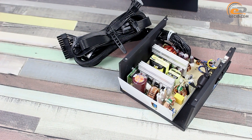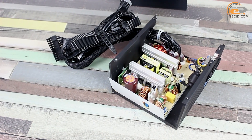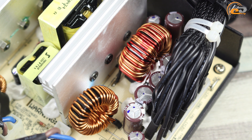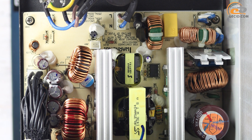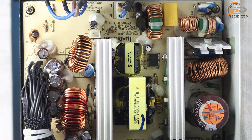The passive part of the cooling system consists of a diode bridge heatsink and two massive aluminum radiators. The major change in the low-voltage section has affected the 12V line. The Seasonic JB platform design divided it into two virtual channels, while here one powerful single channel is used instead — a more preferable option since the main load goes to the 12V line in modern computers.